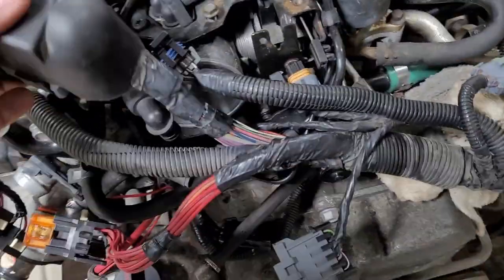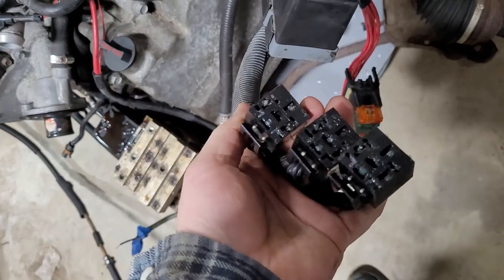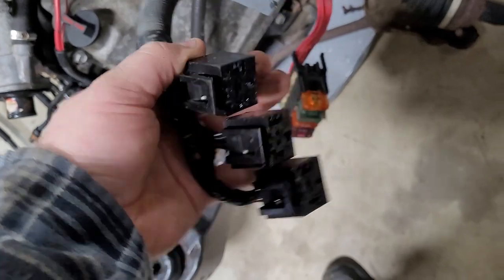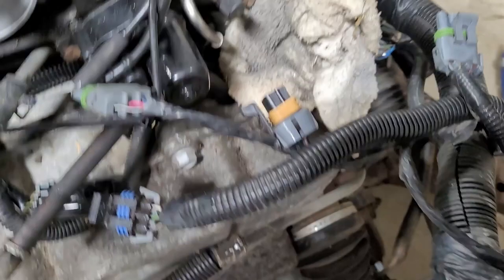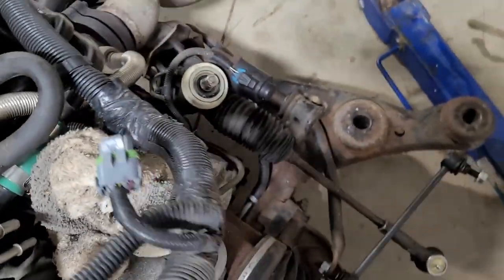As for the driver's side, there's this harness which goes over to the fuse block area. You just gotta free up the relays. There's two 7 millimeter nuts that hold on the assembly. There's a 10 millimeter that bridges there and also connects to that red harness. And you kinda undo those, and there's some brake sensors and stuff, you can disconnect those.